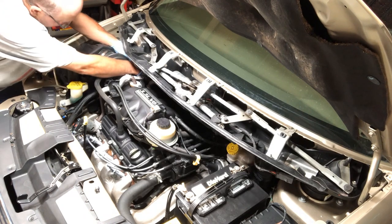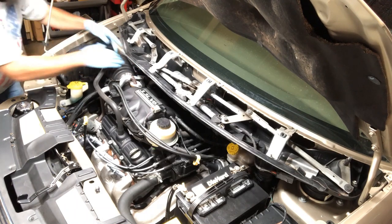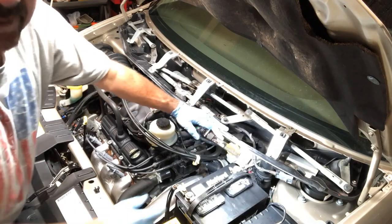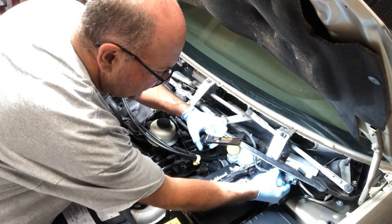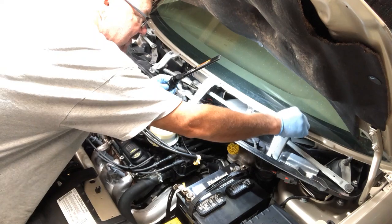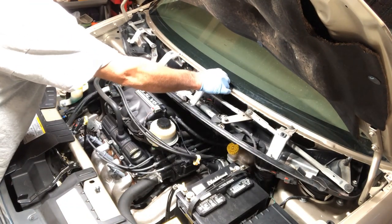The second drain is a little more difficult to reach but you can get your hands in there — slide it back up and push those clamps back together. Now plug in the electrical connection right here and make sure you push down the retaining locking tab. Your wiper motor is reconnected. Take the four nuts along the top and hand tighten them, then come back in with a ratchet wrench to tighten them down.